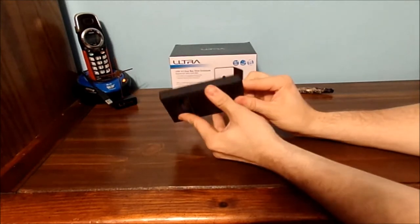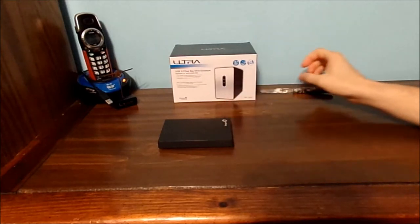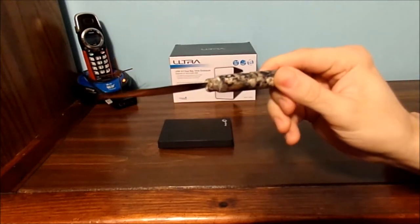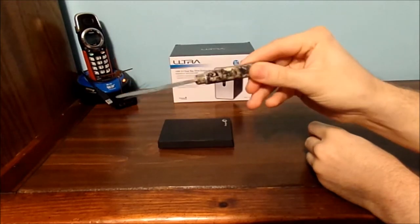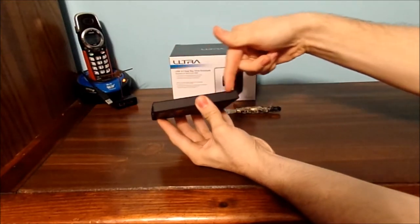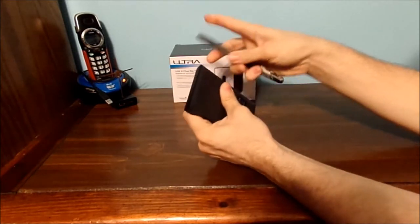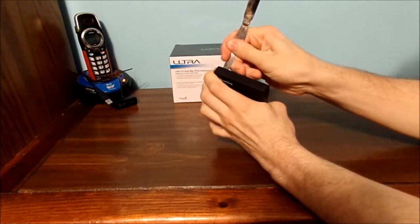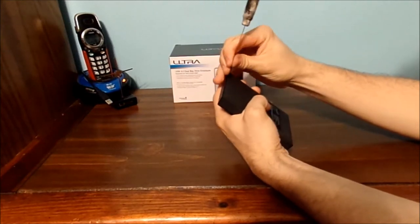It has no screws. It's just a bunch of little clips, and do be very careful and gentle with these hard drives so you don't actually damage them. Of course, we're going to need a very, very thin steel spatula here to open this case. Now, along here, we've got a bunch of little clips. I can start at this end because it's easier to get. Sometimes it might be a little tricky at first, but you can do it. Just have to bend them out.